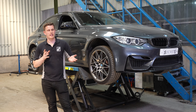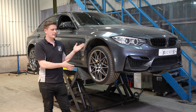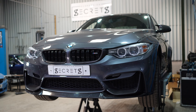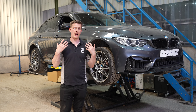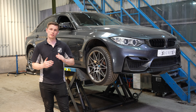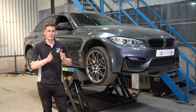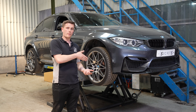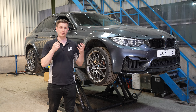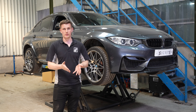We were plagued with brake overheating issues throughout last year, and that's mainly due to the mass of the car being 1,600 to 1,700 kilos — it's a lot of weight to carry on track and to stop. We were just overheating the brakes out on track and they were warping the discs all the time. This is despite proper warming up and cooling down procedures, but ultimately the disc just kept getting warped. We tried a lot of different pad compounds, but every time the disc still warped — it would change slightly in terms of how long they took to warp, but ultimately they were still warping.